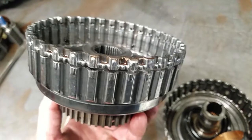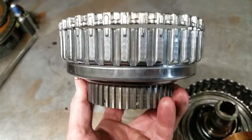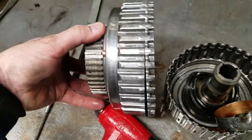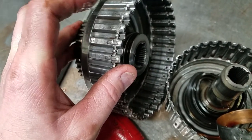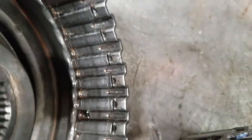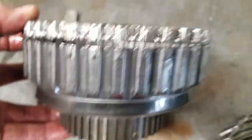The billet piece is much, much more durable, and even if you have little pressure spikes, it does not break the drum. This original drum, just because of the process it undergoes to deform it and make the ring land, is stressed in that area and mechanically compromised because there are sections that are machined out. Basically this drum fails on a regular basis.